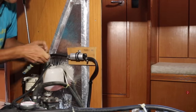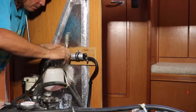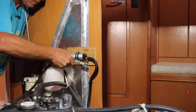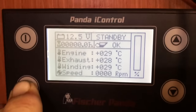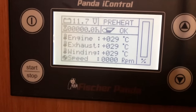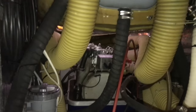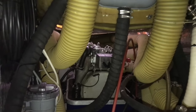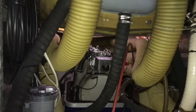A common problem is that even though the pump is running, it could already be worn out and not sending diesel through the tubes. You have probably pushed the start button, heard the fan starting up, and it sounds like even the diesel pump is running, yet the Panda will not start. This could be one of the four most common issues, or even a combination of them.